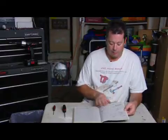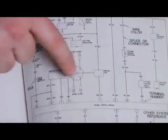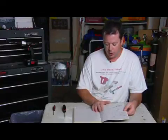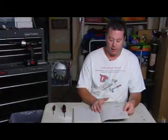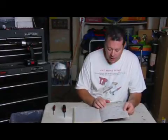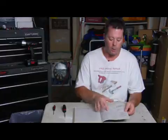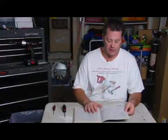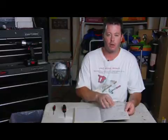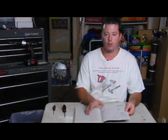Once you've determined that, it's just a matter of looking at the different components and the different wires — where they run, if there's a ground, if it's coming from a hot source. The diagram will tell you if the circuit is hot, neutral, or hot in a run position. Basically, what most do-it-yourselfers want to read a wiring diagram for is to see what each individual wire goes to, and for testing components, switches, or whatever else. Just make sure you know the symbols, the components you're testing, which wires run where, and which ones are your grounds and which are your hot wires.